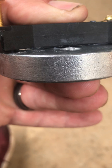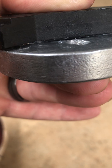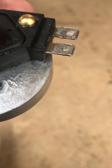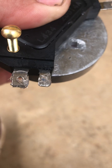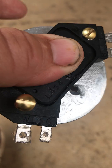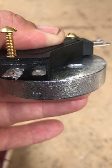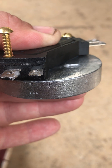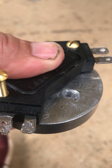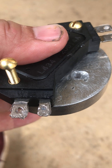Then you're going to put that dielectric grease in there — thermal grease, whichever way you call it — put it in between it, push it down, and then bolt it down. Got the dielectric grease on the prongs to make sure that makes sense. Once you get all this done and bolt it up, you'll be able to bolt it onto one of the plates on the golf cart to ground it out. And we'll come back to it and do that.